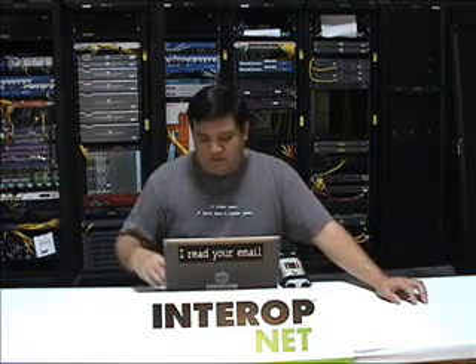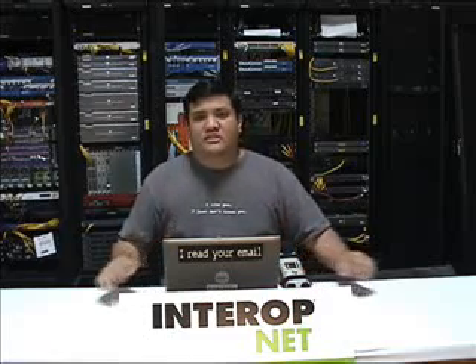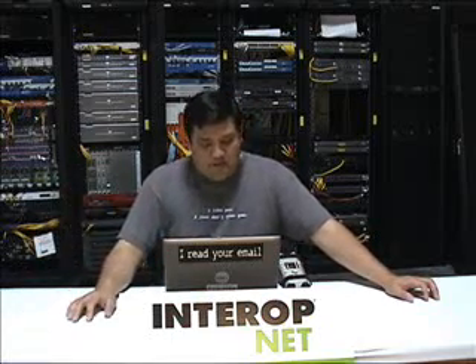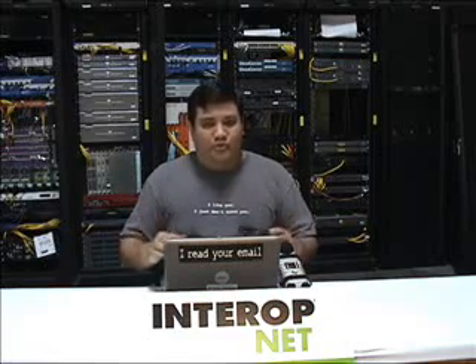Now, if you're going to be using a laptop, I would highly recommend the Dual Head to Go, because unless you're running a gaming laptop, you're probably not going to be able to support the ultra-high resolutions necessary for three monitors. The Dual Head to Go can be found online for anywhere between $140 and $160. The Triple Head to Go would be for those who want to use it at home for World of Warcraft or any of your first-person shooter games — this is going to run you about $270. What I really enjoy about these boxes is that because they are card-independent, I have the ability to move them from different rigs to laptops to desktops without worrying about losing the investment. Matrox has a digital version, but it's not really readily available, so if you need something now, I would highly recommend the Dual and Triple Head to Go products from Matrox.